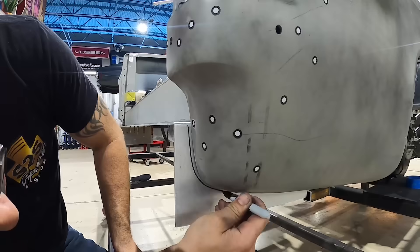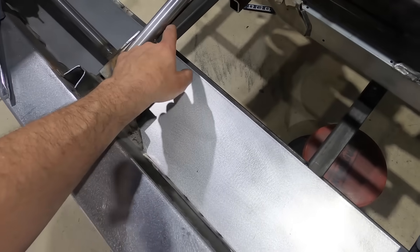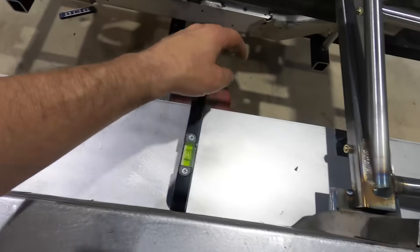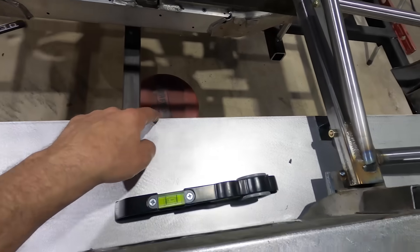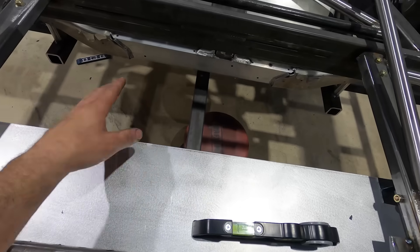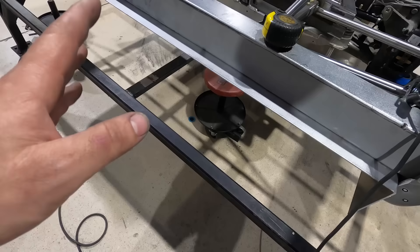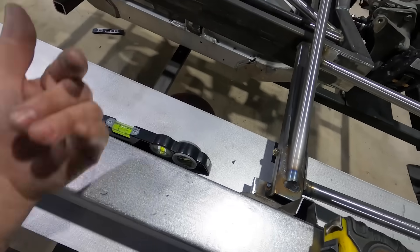We have the beginning of our diffuser in place. This is definitely the biggest diffuser I've ever built - 67 inches from one end to the other. Since there's no bracing on the back, I made these little brackets that will be through-bolted into the chassis to secure the rear positions on the diffuser shell. From there we have a piece we're going to plasma cut to connect from here to the edge of the Tesla aluminum subframe. Once we have the angle we want, we'll tack it in place on the truck, take it to the bench, weld it up, and start laying out our fins which will give it that really cool JDM JGTC race car look.